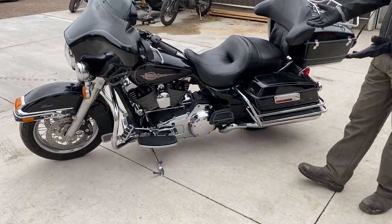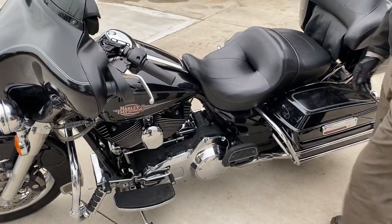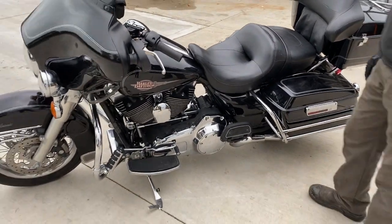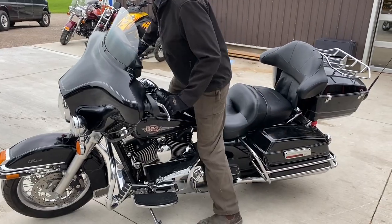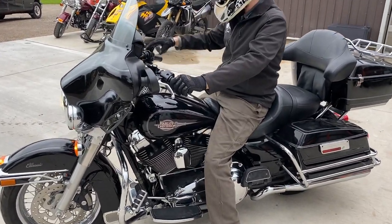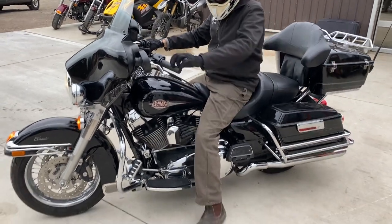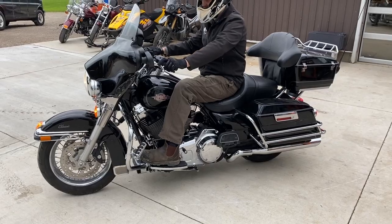Automatic clutch is installed. We've done a bunch of adjustments and warmed it up and got everything ready, set free play, everything like that. We basically should be able to drop this into gear and the bike will not move. There will be slight forward creep, slight forward motion. Our adjustment should ensure that there is not any excessive creep.